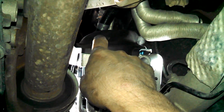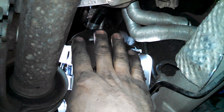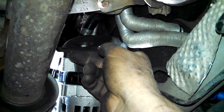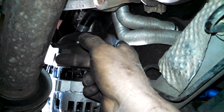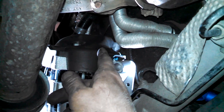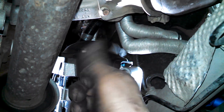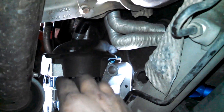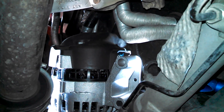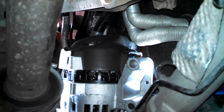I got the shield on. I was going to start putting on the alternator wiring, but that stuff goes on easy — the 10 millimeter nut and wire for the battery positive is easy, and the plug-in you just snap into place. You do not have to mess with that little push tab. Got this on, 13 millimeter bolts back on tight, then we can lift it up into place and put the studs in. We can plug the alternator in a little bit later.